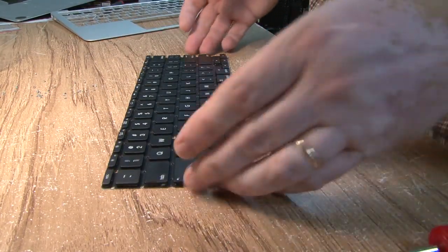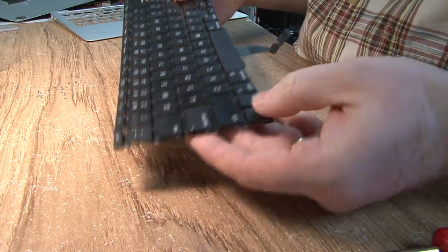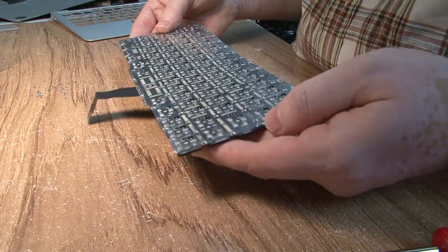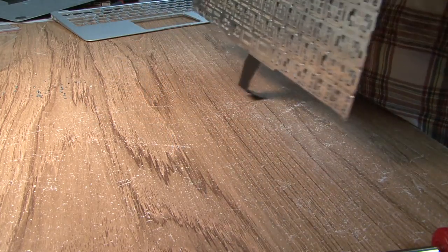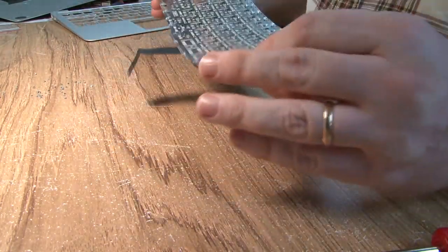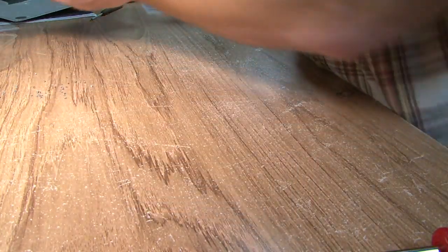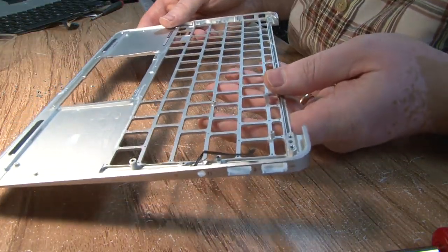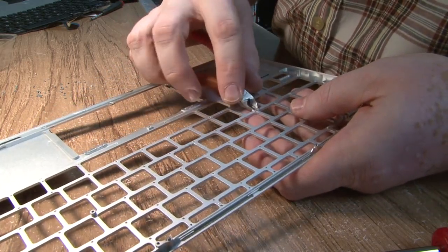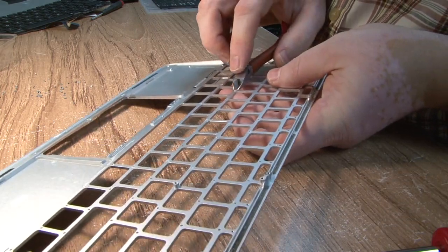We have separation — the keyboard is in fair condition, so it would be salvageable. If you have a MacBook Air with these rivets and you want to sell the keyboard from it, that's how you get it out. Now it's a matter of putting a new keyboard in, putting the screws in, and getting it working. You can use some snips to grab hold and pull the remaining rivets — they're just falling apart.